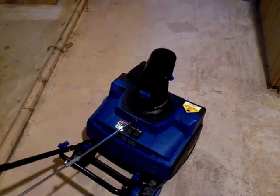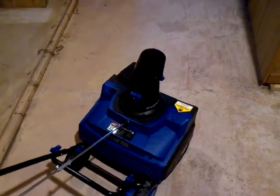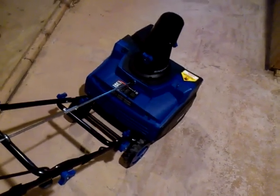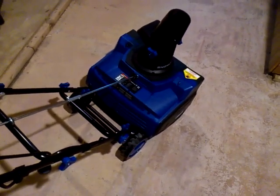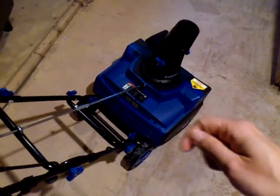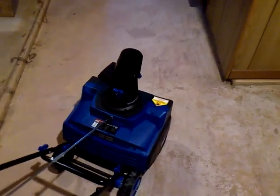The motor will slow down when taking on too much snow — it's a light-duty unit, keep that in mind. This unit would most likely work best if one were to break up the snow with a shovel first, essentially scatter the snow in a path, and then take on the snow with this unit. Also, due to cable management, it's probably a good idea to set forth a path that involves going forward and away from your cable source, and not having to backtrack — I found that when backing up or turning around I had to always be aware of where my cable was.